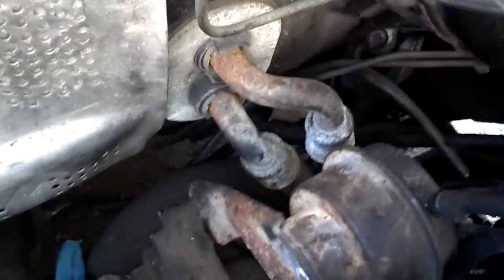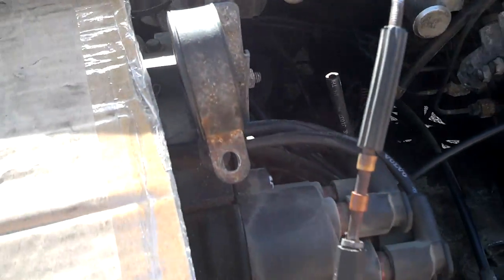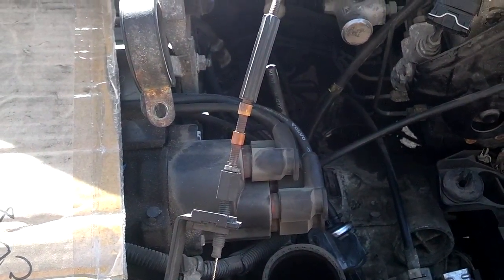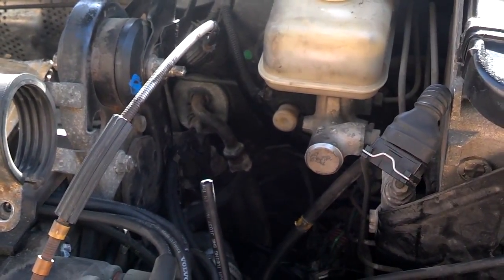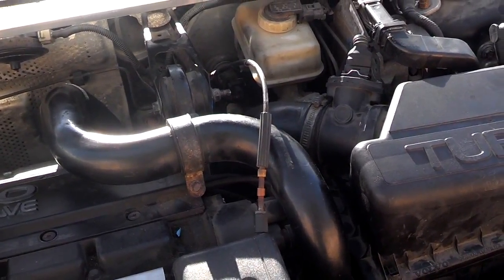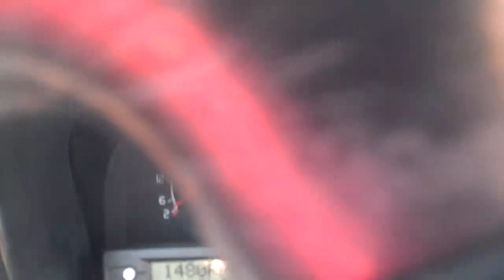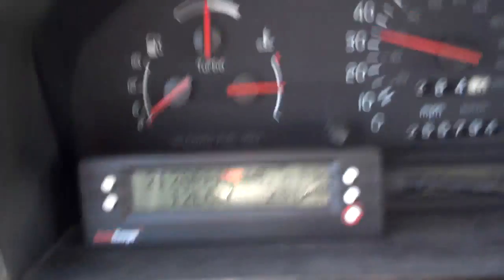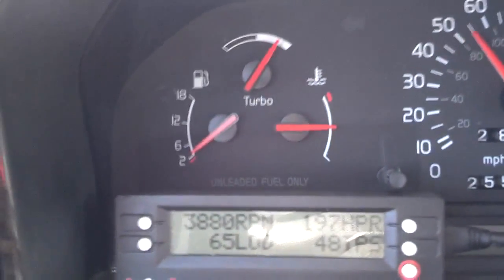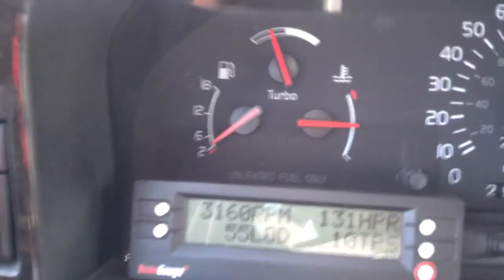I got the vacuum back on top of the wastegate, I got my valve installed. Now I'm going to reinstall all my tubing and stuff. I had to take my gloves off to get those bolts started, but I did get them started pretty quick. It took me 15 minutes to get that valve off, and about 18 to 20 minutes to get it back on. I got everything back together and I'm going to test drive the car. I'm getting ready to put my foot in it — it will show you the boost level and there's RPMs, horsepower, load, and throttle position on the gauge. Looks like it's boosting about 12 to 15 psi right there for a few seconds.